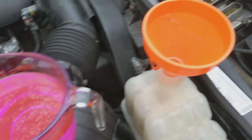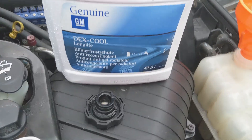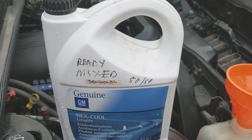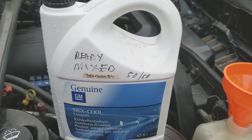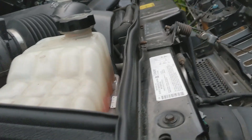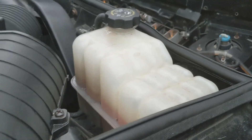I'm going to add the coolant back in — starting with at least six litres to see how much we can get in. We're using Dexcool 50/50. GM says you can use tap water but I use deionized water here in the UK — distilled water is hard to come by and deionized is the best I can get. I filled up, ran the engine for a bit to get it warm and work the fluid down. I've put in about seven litres. We'll take it for a drive and then come back and check.